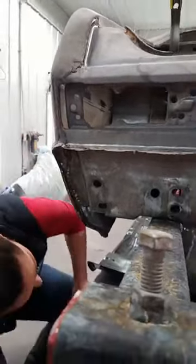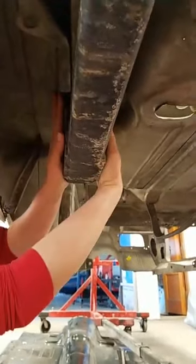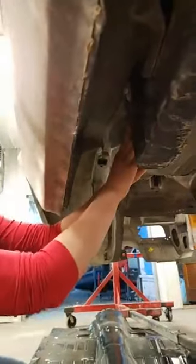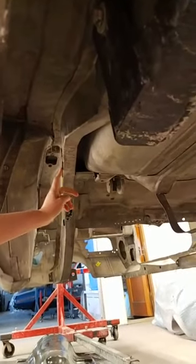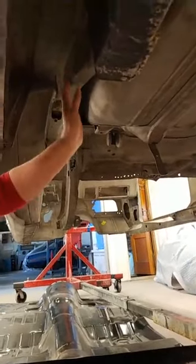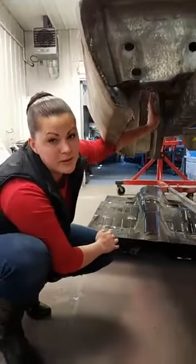Underneath, we're just starting to get into the structural issues. This is the rotisserie — mounted on either side on the frame rails. But there is a buckle in the frame rail just in front of the rotisserie mount, and there's some sort of a repair. Until we take it off we won't understand why they did it, but there is a plate welded in place here, and there's additional wrinkling all along that frame rail. The other side doesn't mirror those imperfections or any of these added brackets, so that's how we know they're really not supposed to be there.